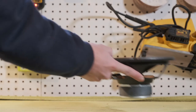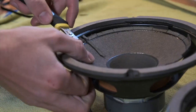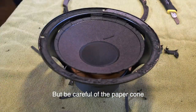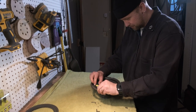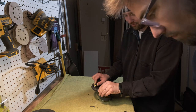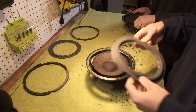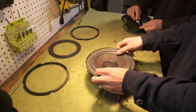It's pretty easy to fix — just a bit tedious. You start by scraping off all the old foam and removing the gasket that goes around the outside of the speaker. You have to clean this really well, get that gasket off, and clean all the foam off the speaker cone and the metal basket. Sergi popped in to help clean the other speaker. It's important that all old foam is removed so the new foam surround will adhere properly, because these speakers are a sealed design, meaning any air leaks will diminish the sound quality, especially the bass.